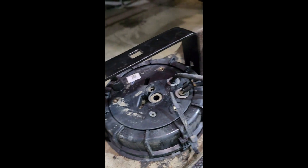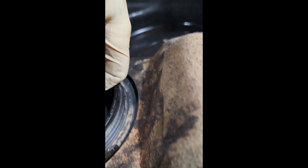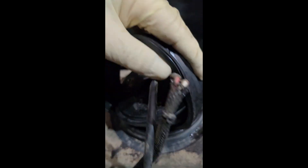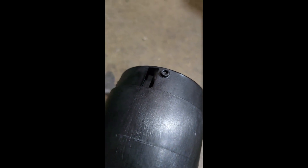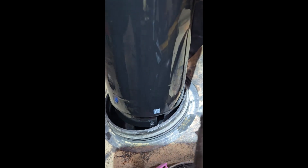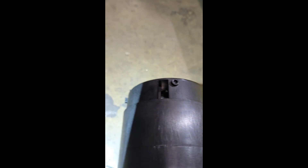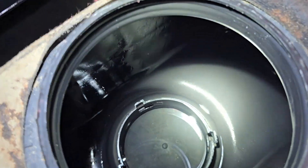You want an adjustable tool — put a ratchet on it, break the ring free, and take it out. Work the lid up; you'll have a seal in the middle. Pull the seal out and work it up over the outside to get it out of the way, then rotate the inside counterclockwise because you have tabs that lock in. It'll be one little click and then it comes out. You can see the four little tabs — it goes in and then turns. Remember which orientation the pump was in and note the notches so when you put it back you push the element down and turn it clockwise until it clicks.